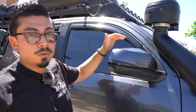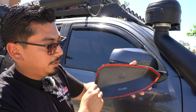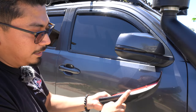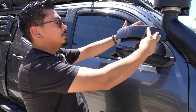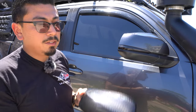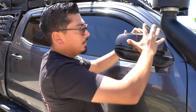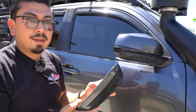Once you've done a good cleaning job and let it dry, you're going to want to get your brand new carbon fiber overlays. Flip it on its backside and you're going to notice there's a red stripping around it — peel that off because underneath is where the double-sided sticky tape is. There's also a lip here at the top and a lip down at the bottom, so this is going to clip in. After you've taken off the tape, you're going to stick it over — each one goes to one side, passenger side and driver side. The clips kind of clip in forward, then you bring it down and give it some firm pressure so it clips over the bottom, then hold it for a couple seconds so the tape really bonds to the paint and you're done.